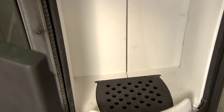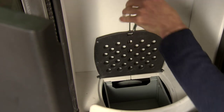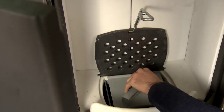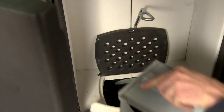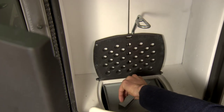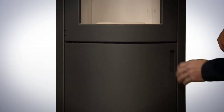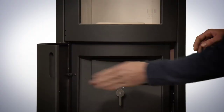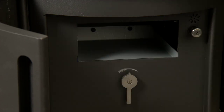The disposal of ashes is convenient and tidy. For stoves with a grate and ash box solution, Ben lifts up the grate with the supplied hook, places the lid on the ash box and locks it. When reinserting the box, Ben takes care to place the cut out towards the air flap. If the stove has an ash drawer instead of an ash box, he will close the grate first, then simply pull out the ash drawer.